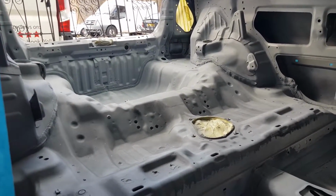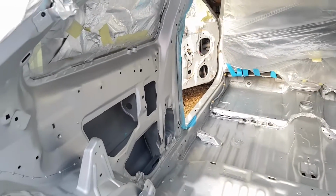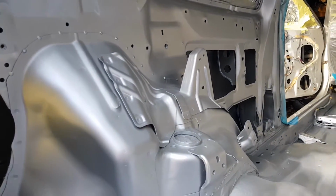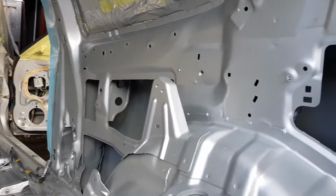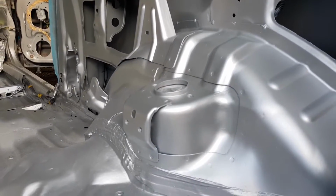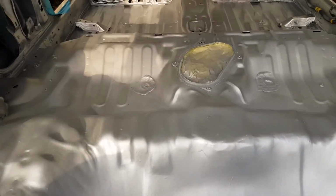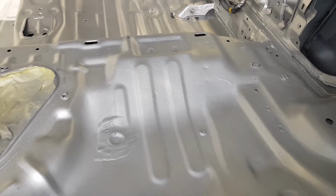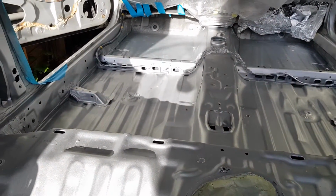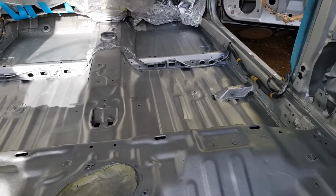So let's get cracking. Well then, it's up at 6 on Saturday, and the interior is now all one colour. The side panels look decent, the arches look decent. I'm quite happy with those. Got to do the clear coat tomorrow morning, leave all this to finish off drying overnight. But it gets a bit ropey when you start looking down into the boot floor and onto the back seat bench area and in the footwells, because that was all the stuff that had been hand painted, brush styly. So not a lot I could do about that. I was not prepared to go back to bare metal with it because I just haven't got the time.